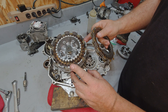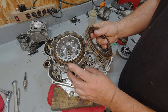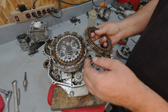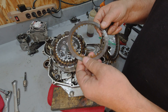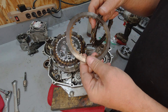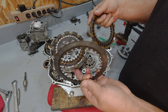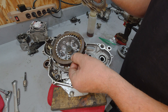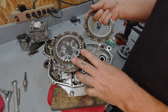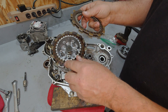If you ever got a bike where you get the clutch pulled in all the way and the thing still feels like it's dragging or wants to pull, either you're out of adjustment or a lot of times what happens is when these metal plates get overheated, they'll actually warp — they'll twist a little bit. And when they twist, because there's such little gap between all of this stuff when the clutch is pressed, it will cause the clutch to drag. So usually replacing the entire clutch — meaning frictions, steels, and new springs — will take care of that problem.